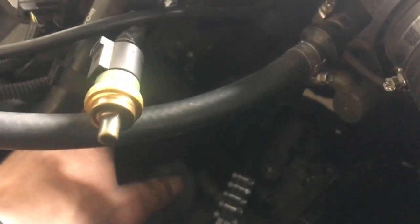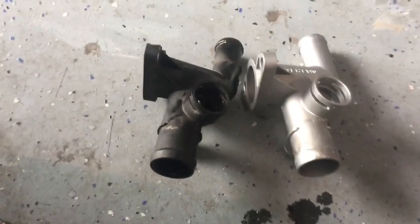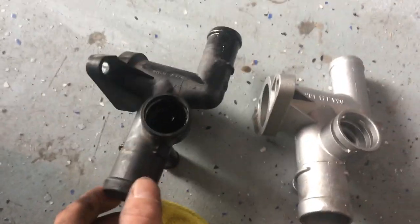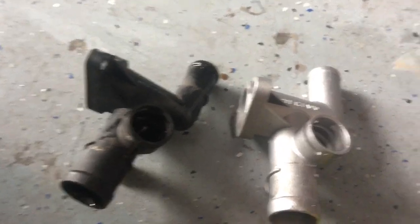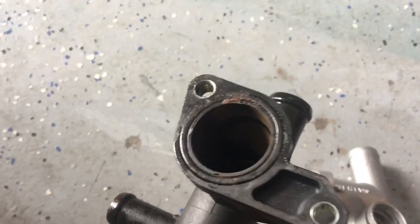Next is this plastic flange. I already took out the sensor — I think it's a 10mm to get it off, just two nuts. Here's the main flange piece I just got out — the trusty old 16-year-old one versus the brand new one. This o-ring is all squished but I don't think it was leaking. I have a new gasket here though.